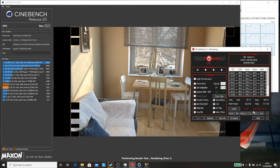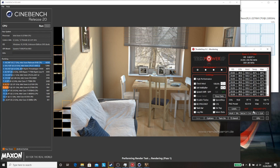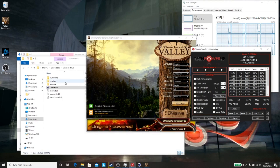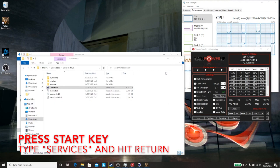This P1 runs pretty well with just the CPU going, but it will throttle back once the temperatures hit about 97 degrees. The fan isn't overly loud, which is quite a nice feature on this P1 series. In order to keep the fans at this noise level and the temperatures as they are but gain a little more performance, we're going to undervolt this CPU with Throttle Stop and also remove the Lenovo throttling service.